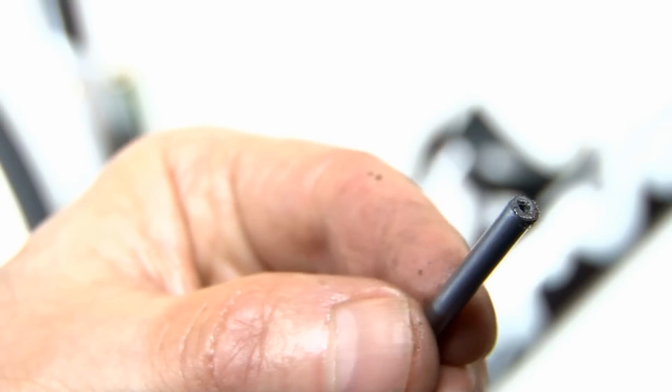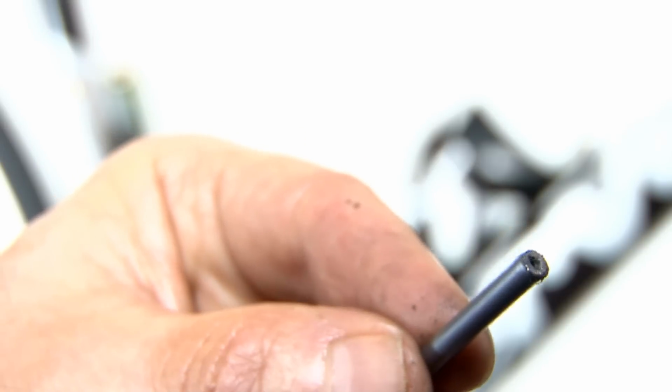It's very important that you use proper bike cable cutters because electrical cable cutters will simply crush and fray your cables. Proper bike cable cutters are easy to use and make this job a lot easier to accomplish. Make sure that the outer cable housing has been cut cleanly. Ensure that there are no burrs on the inside of the housing. Those burrs are going to hinder the easy movement of the inner wire, causing your shifting to be very poor.